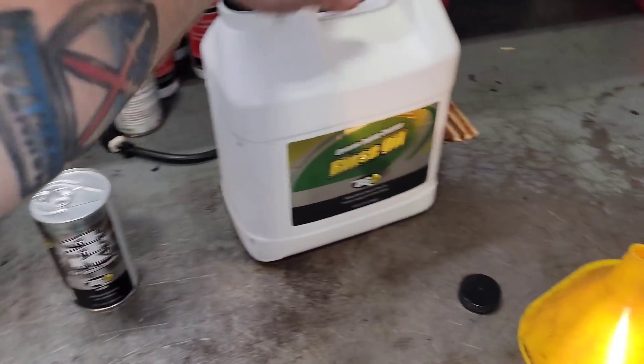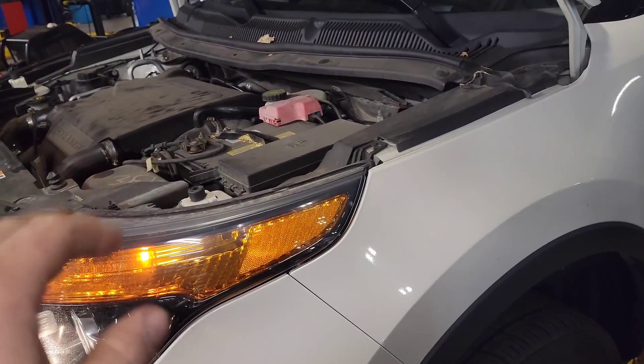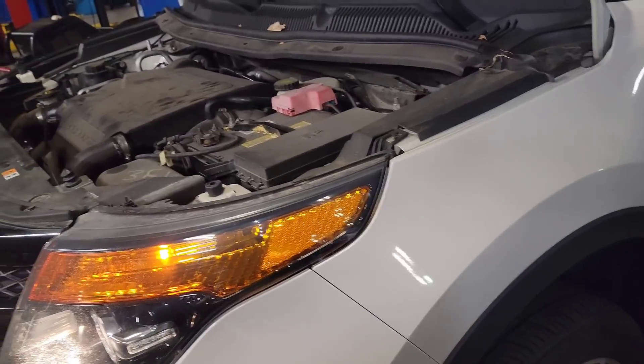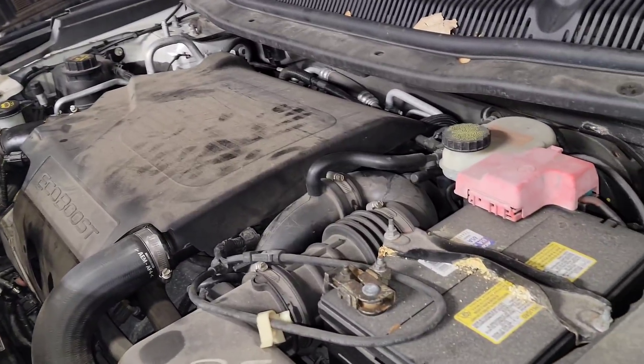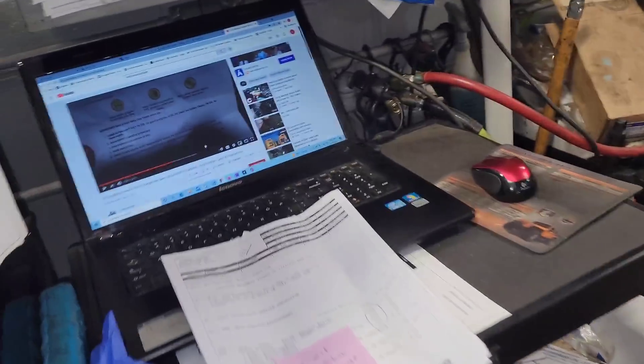The kit includes the 44K, the rinse oil, and then there's a dynamic engine cleaner. You get it to operating temperature first, drain the old oil, pull the filter off, dump the engine cleaner in and top it off to the proper level with fresh oil and a fresh filter. Then you run it — the instructions say about 3,000 RPM for 45 minutes. If you watch my old BG video I put the actual instructions in the video so people can see how they want it done.